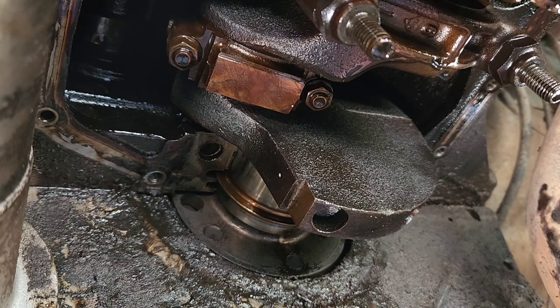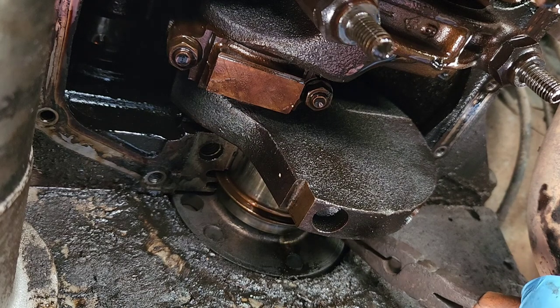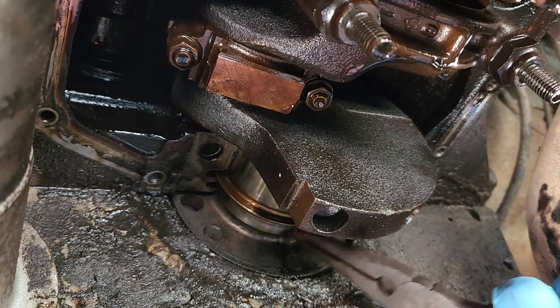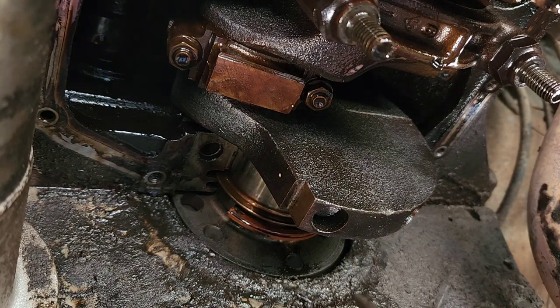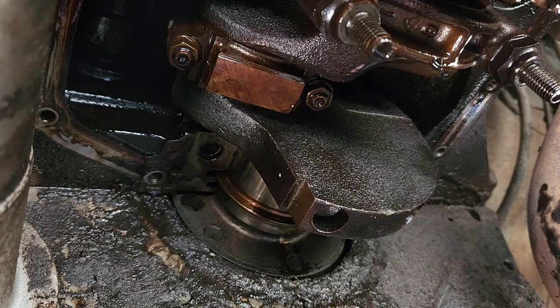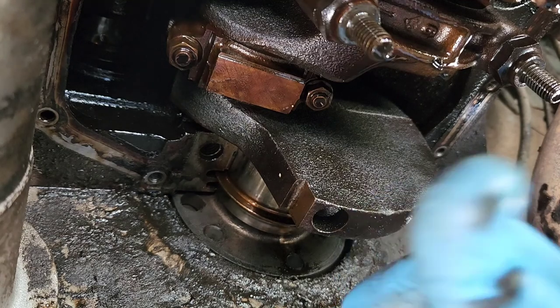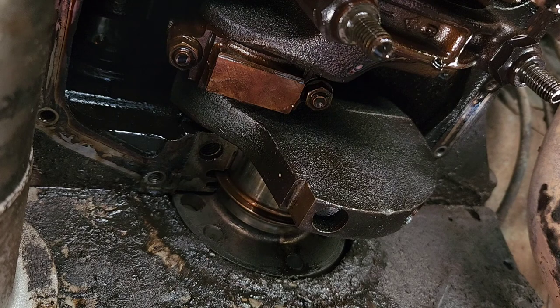So, got the needle nose, and then you just want to take note of the orientation of the seal itself. I know it says it on the package, but if you just put it back the way it was, normally you're okay. So this is how the seal came out, just like that, with that ridge going forwards. I'm gonna grab my new seal, make sure it's the same one. So ridge going forwards. I'm just gonna dip it in some new oil real quick,